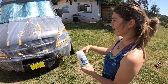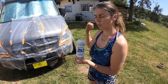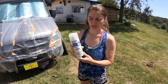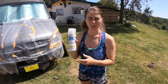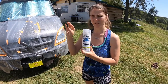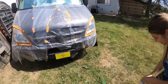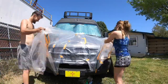We're going to wait 24 hours, then remove the masking. After 24 hours, you have the option to wet sand with the 2000 grit. You do this because spray paint creates what's called an orange peel effect — it's kind of splotchy from the spray. The 2000 grit lets you lightly wet sand that off so it's smooth without the spray paint texture. Then you're going to wax your lights because they're painted and protected now, just like your paint job.